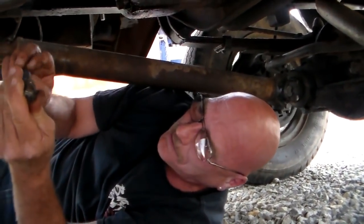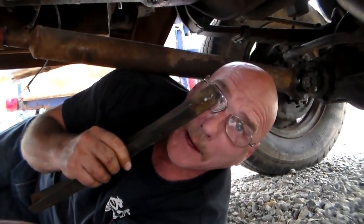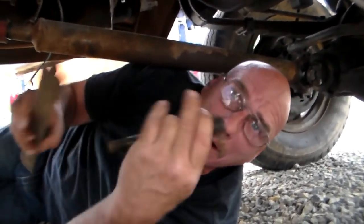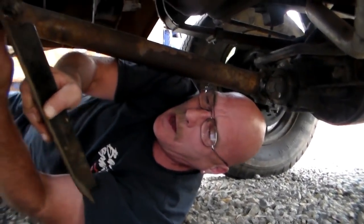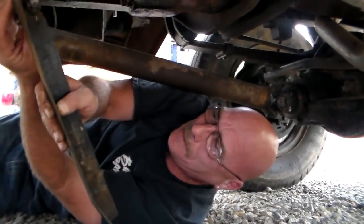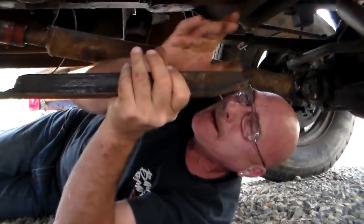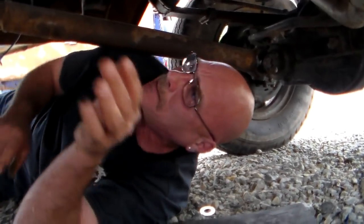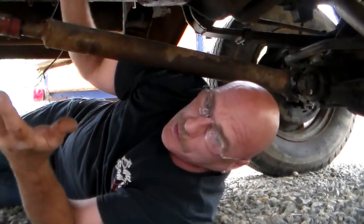But instead of fixing the threads and putting the nut on the end, they took this piece of iron right here, which is a good thing I have my safety glasses on today because I actually broke it off and this piece flew off and hit me right on a glass lens right there. Praise God that my eyes are okay. They had this cobbled onto here on the end so that the bolt wouldn't fall out because it didn't have a nut on the end, and then they bolted it to the frame up there. So they just added a big chunk of metal that it really didn't need because this is super strong right here. These things are securely mounted on there now, if you just put the right bolt in.